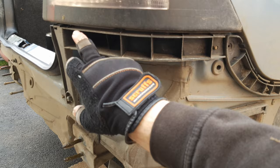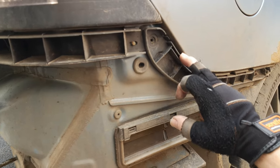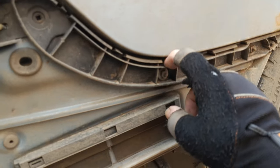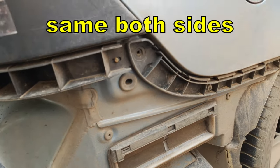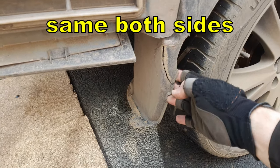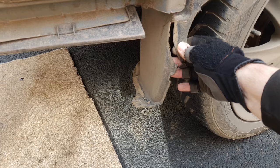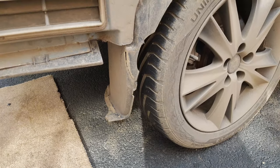Being pushed forward where the bumper fits in round the bottom of the lights and the bodywork into this bracketry, the clips that hold the bumper in - quite a few of them are broken, there's one that's not - so I need to replace all of that. And having been pushed forward where the bumper attaches to the wheel arch liner, the wheel arch liner is snapped and broken in places where it's attached, so the wheel arch liner also needs replacing.